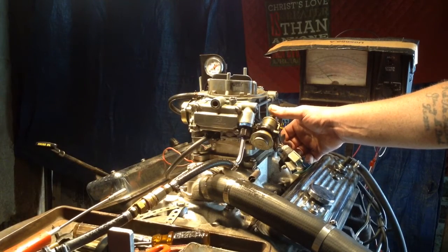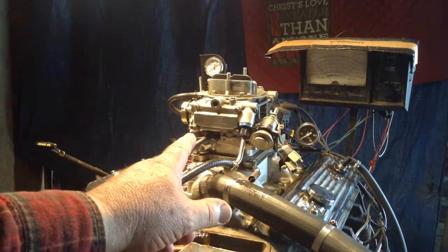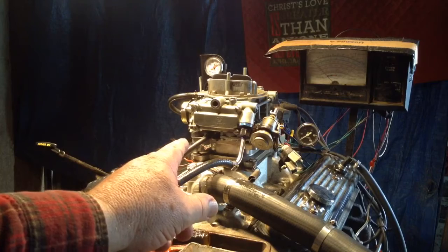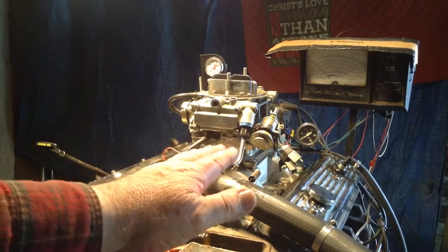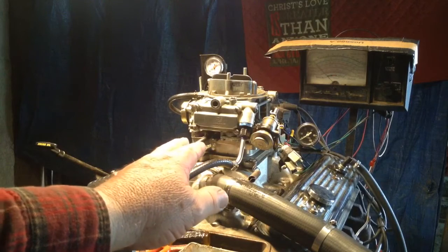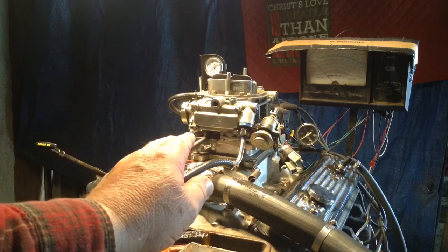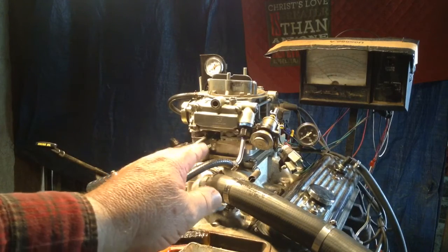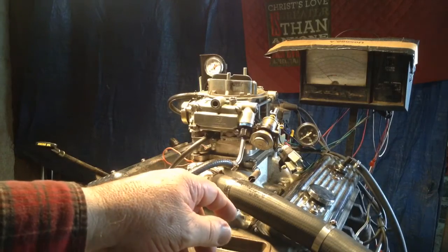Okay, that's enough. What we found out: the back barrels do activate. We'll have to check the electric choke and the electrical circuits. It's gonna need a rebuild because it won't idle and it won't accelerate, which is normal for a carburetor that was built to run on leaded fuel. No sense making a lengthy video of it — we'll take it in and get it rebuilt.